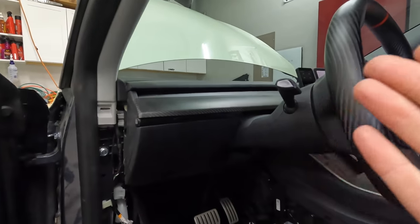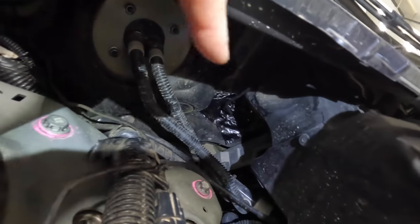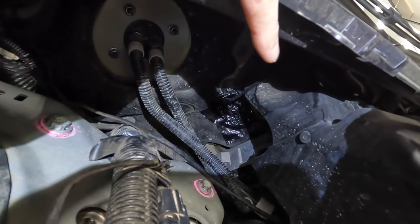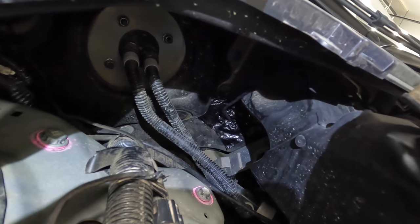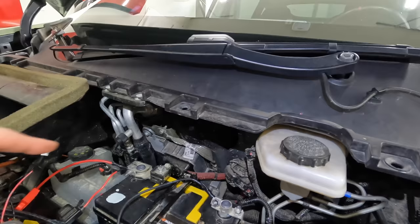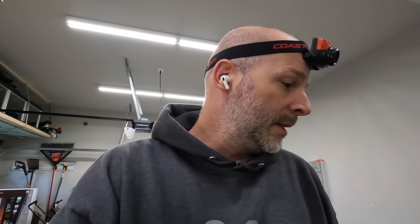I've hooked up to the autopilot computer and popped through the firewall. On the Model Y there's a grommet right inside the frunk area — on my car, VIN around 409, it was just a foil cap, not a real grommet. I poked through and sealed it with material. I ran the wire up and over. There's an inline fuse — connect positive and negative and we'll have power to the system. These lights are a lifesaver — dark carpet makes it hard to see in there.